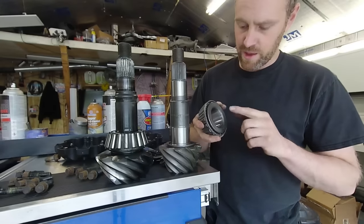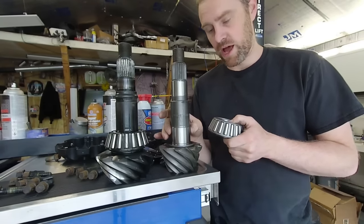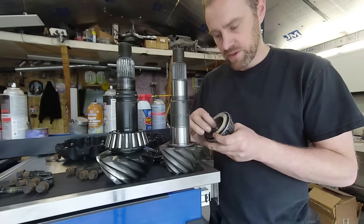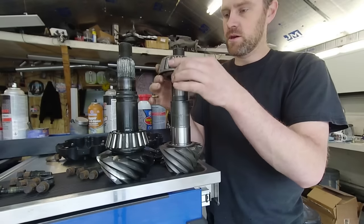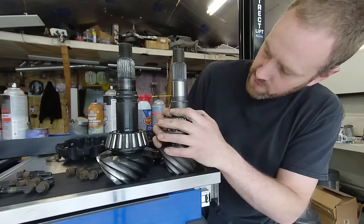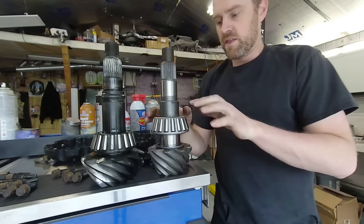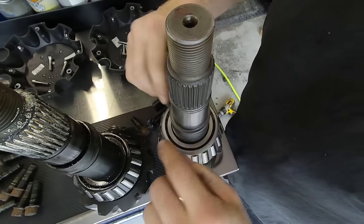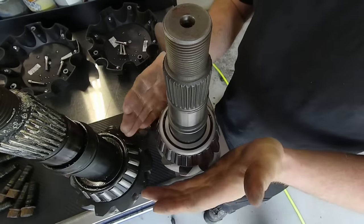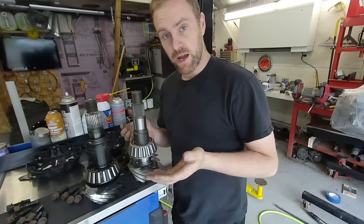When it comes to fitting these things — honing out the back side just a little bit more than the front — it creates a wedge effect. That helps when you're applying the bearing, because the slight contour isn't always enough to completely center it. By honing it to a very light press fit, you create a spot where the bearing will actually drop below that area because it's bigger — it's not a press fit at the bottom. This one is very close to where I need it; it allows me to get it down just far enough that it self-centers. If I look at the top, I can see an even gap all the way around the pinion, which means it's going to press on nice and straight.